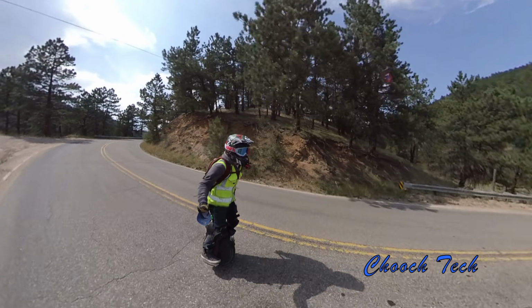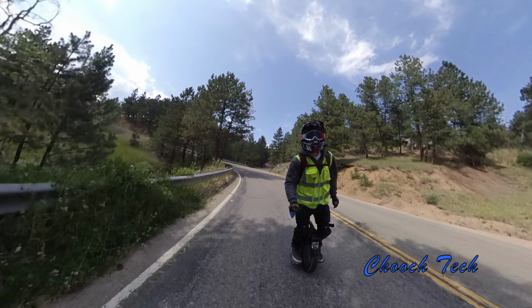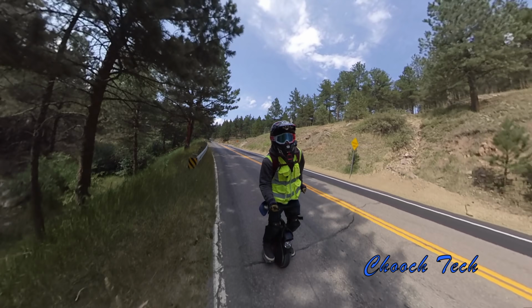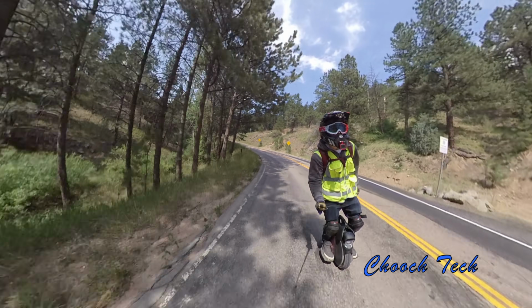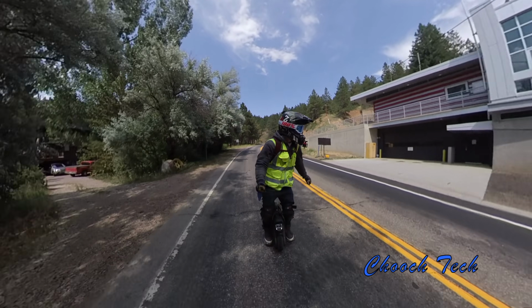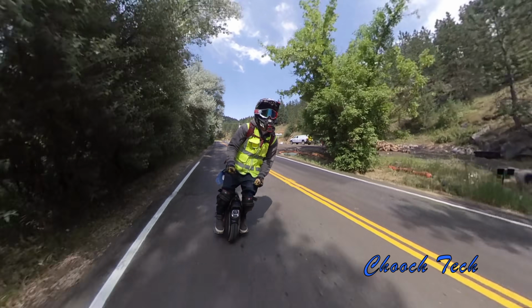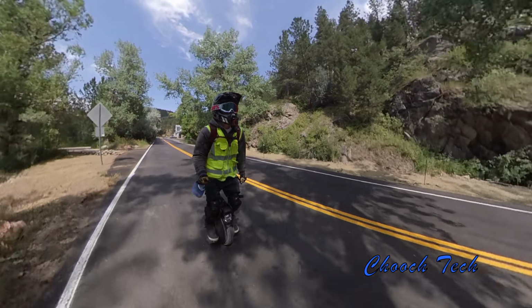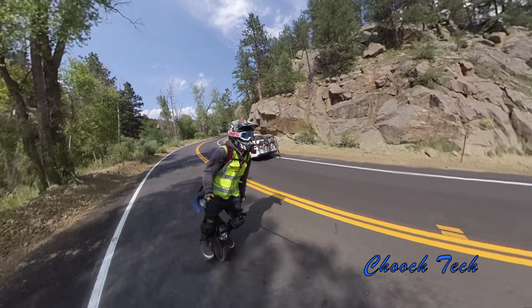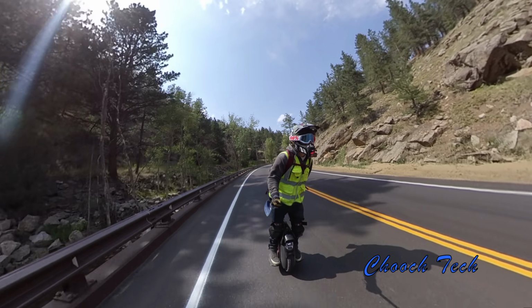It is amazing me looking at these Inmotion videos of people riding, and just the way they have this thing just pumped up, and it is just not working. There is no point of having suspension if you have 200 pounds of pressure in these chambers, okay? I'm 130 pounds. I'm riding with 80 in each side. You can adjust that accordingly, but I'd say if you're a 180 pound rider, you need probably about 105 to 110 pounds in these chambers, and no more than that.